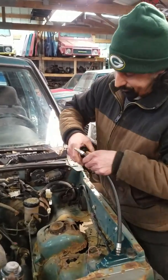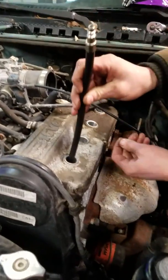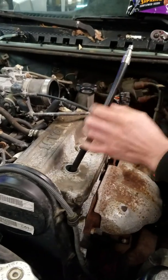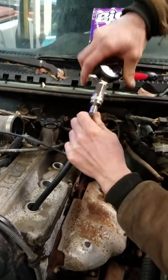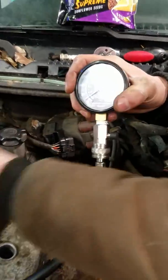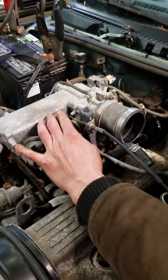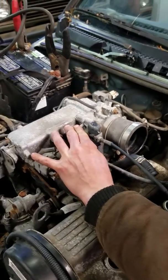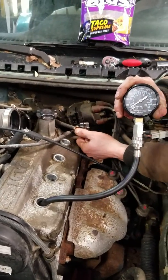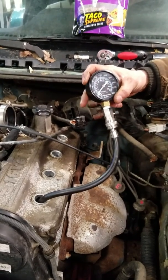Sometimes it's easier to have the gauge off, but with your plug out you're just gonna want to stick the fitting in there and screw it down hand tight — that's all you gotta do, nothing crazy. It's got that rubber o-ring so it's gonna seat. Click your gauge in there and you're set. You've got to have the throttle in the wide open position to run your tests, so either have somebody inside with their foot on the throttle or pin the throttle linkage open, otherwise you're not going to get appropriate readings. So again: all four plugs out, distributor disconnected, fuel pump cut off, wide open throttle, gauge installed — you are ready to go.